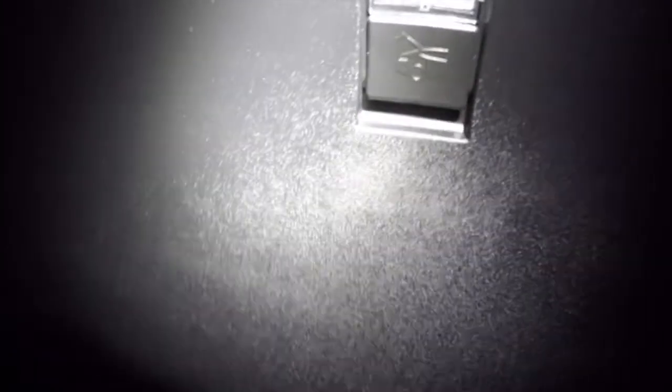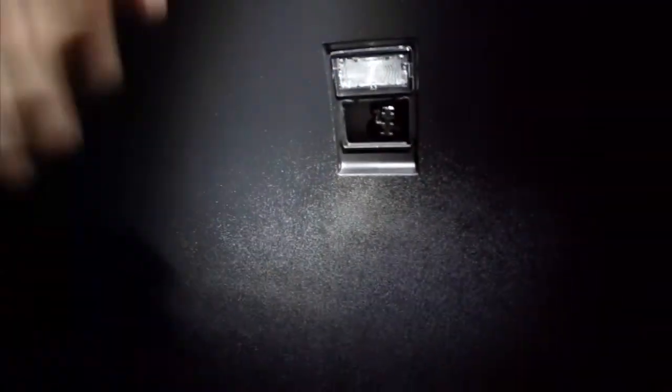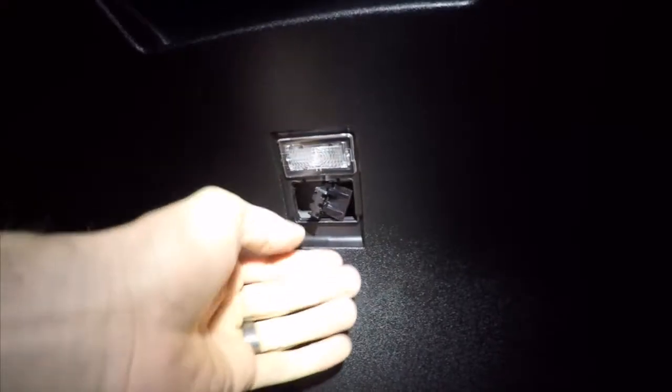As you can see here on the screen, our door is now open. Here we're taking a look at the back trunk of the vehicle or the back hatch of the Model S. I'm actually inside the trunk and we need to get out. The electronic power is not working, so none of the buttons are working and the remote is not working. So you pull off that plastic piece there, and now you have again a cable pull with a little plastic piece on it. The manual release is activated and we're able to open our trunk.